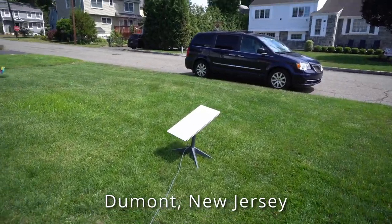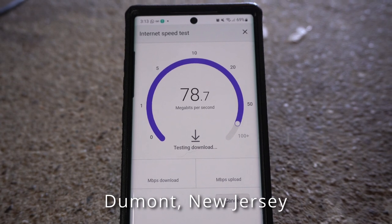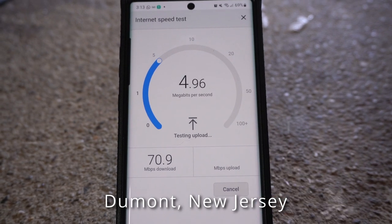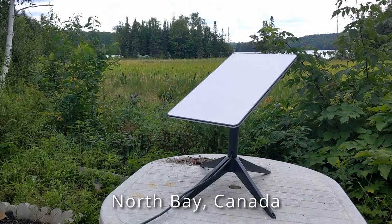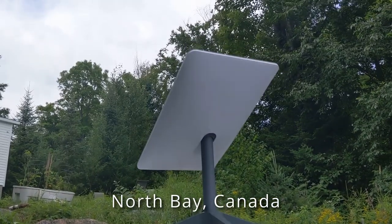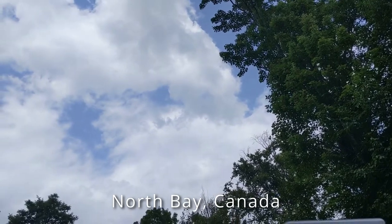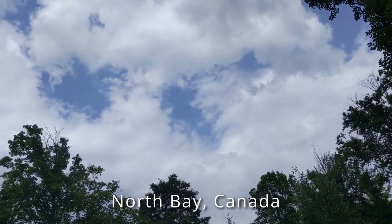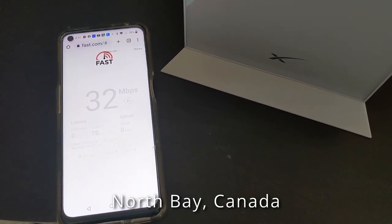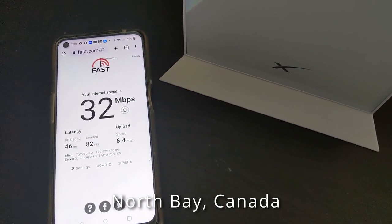Using the Google internet speed test I'm getting around 70 megabits download speed, but the upload is not as great. Here we are about four hours north of Toronto, Canada — this area has just been recently activated by Starlink. To the south we have a whole lake with no obstructions, but the Starlink antenna keeps looking to the north where unfortunately we have a few trees. These are the kind of speeds we've been getting — not great. Maybe if we move the antenna to a higher point or somewhere not obscured by trees we'll get better signal.